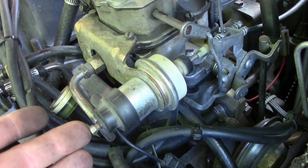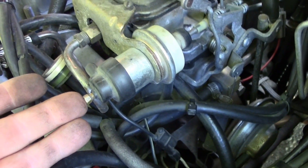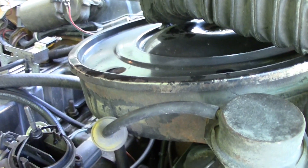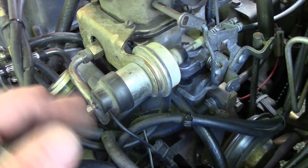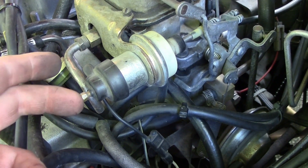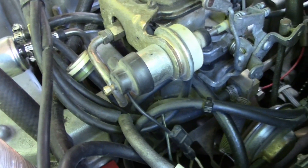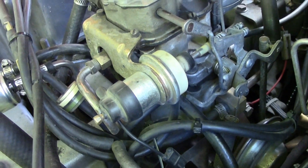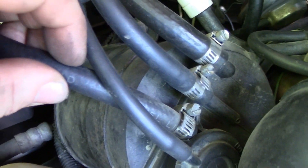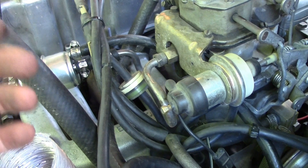Because we have a computer here, we also have this little buddy right here. When you start your car and it detects that the engine's hot — and it knows it's hot because it has a temperature sensor in the air cleaner and a temperature sensor hiding just right there behind that red metal clip — it'll actually nudge the idle a little higher than usual. That's simply to ensure the engine has slightly higher RPMs, it's pumping more gas, and it's purging all the vapor out of the system. It can go to the tank and do whatever it wants, or it can collect and get pulled into here — because now you'll have a vacuum on this line, it'll purge out the charcoal canister, and it'll continue to do that while you're driving. And that's how you can fight vapor lock in a carbureted engine.